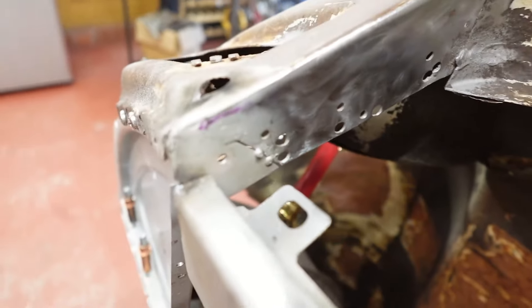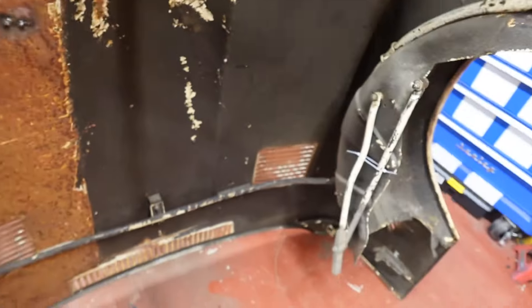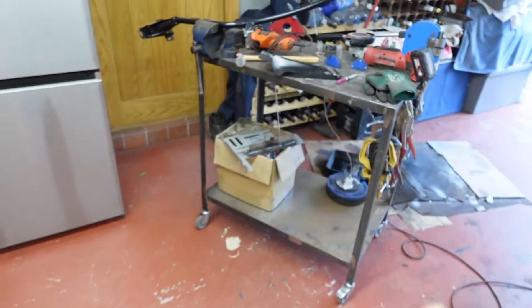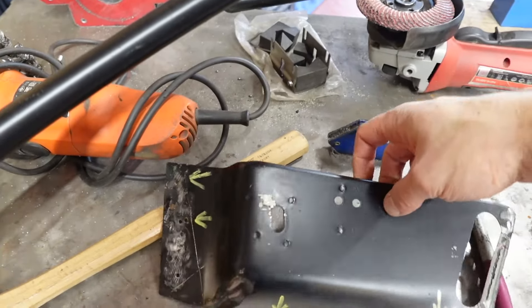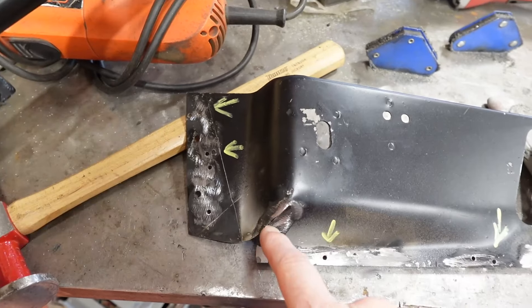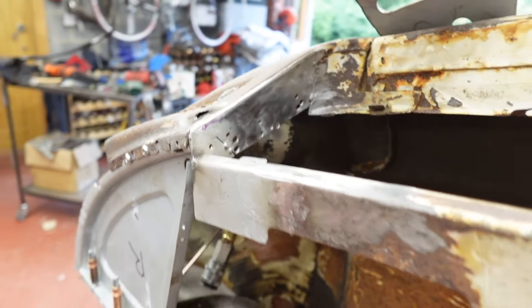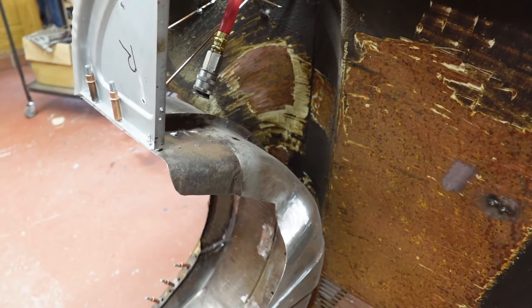I've started towards cleaning up this area ready for welding. I've just had the blaster out and gone up in there because I couldn't think of any other way to do it, despite the mess which I've now mostly cleared up. You can see it's everywhere — bits of grit. Going to get the edge of this cleaned up and that little bit, because I want to run a weld down there. I want to get it primed, wait for that to dry, get everything sat in place, and then take the wheel arch off and prepare the wheel arch.